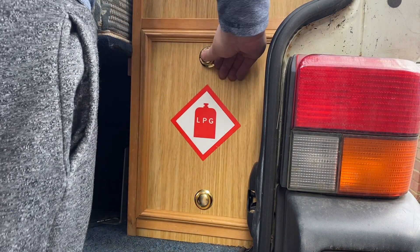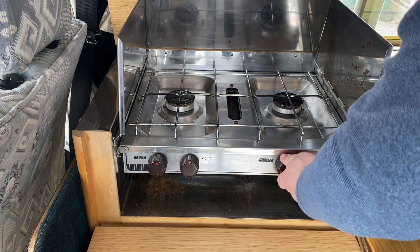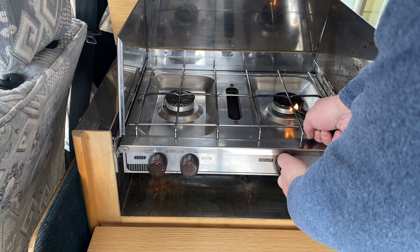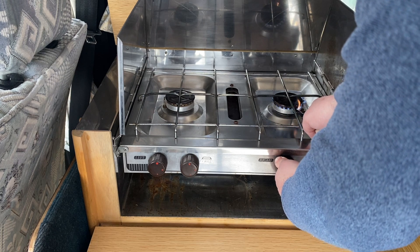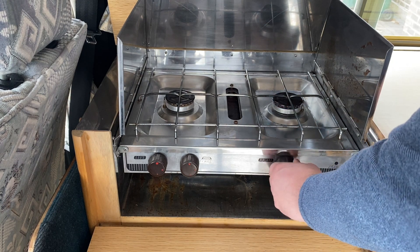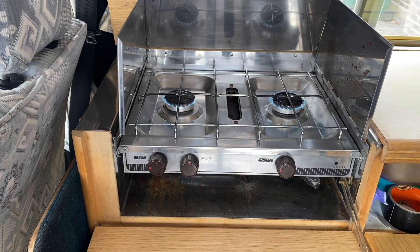There we go, job done. The hardest part was getting the straps around the bottles, if I'm totally honest with you. Let's go inside and give it a little test. I've turned the isolator valve on inside the van which will allow the gas to come through — it's just going to take a couple of seconds, maybe 10 seconds, for it to properly purge through without any air gaps. As you can see it does light up and we've got a good flame on there. Let's try the second hob as well — it seems to be a lot more pressure. I'm taking an educated guess there was a bit of a leak on it with the smell of gas. As you can see the cooker fires up absolutely fine. Hopefully it will make the fridge a bit easier to start now as well with a little bit more pressure behind it. Anyway, that's it, thanks for watching.